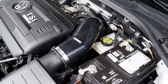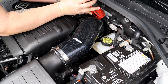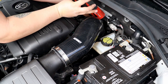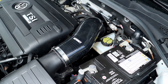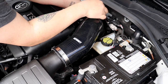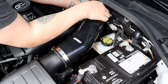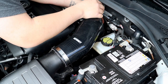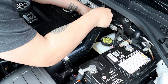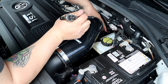The clamp was hitting on one of the connectors in the back so it wasn't sitting all the way. That is why you can see I'm just using an Allen wrench that I had on the side — I didn't want to use a flathead as I didn't want to puncture the hose. So I'm just pushing little by little with the blunt end of the Allen wrench to push the clamp all the way down so it's sitting properly, and when I clamp it down it's going to be clamping properly.